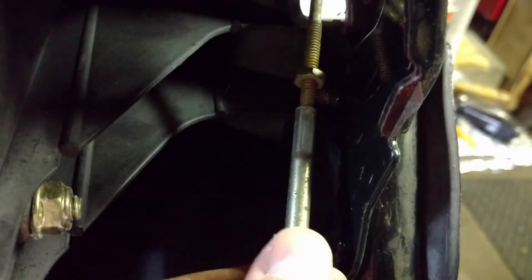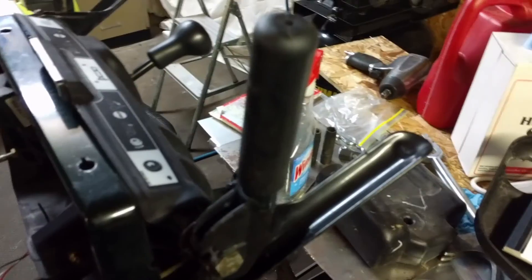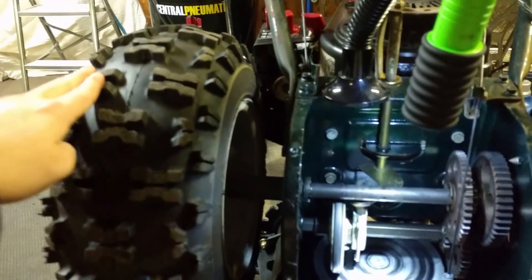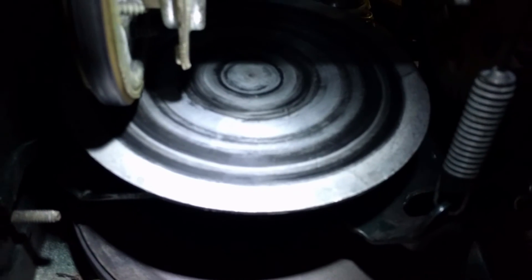You can see I just got a little quick clamp there. What we're going to do is tighten this up and bring it to a point just until I can feel it start to get a little bit of resistance onto it. We'll go ahead and tighten up this lock nut — just doing it finger tight for now. Get your quick clamp, clamp that, and then we'll go back down and check to see if it's slipping. Now when I try to rotate the wheels, it doesn't want to rotate — the friction wheel is applying pressure to this plate.